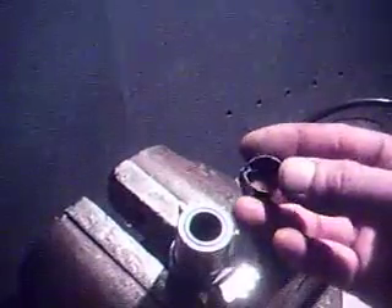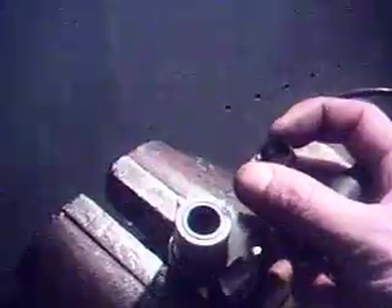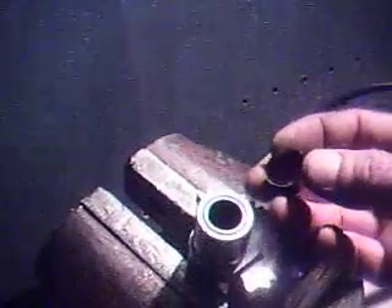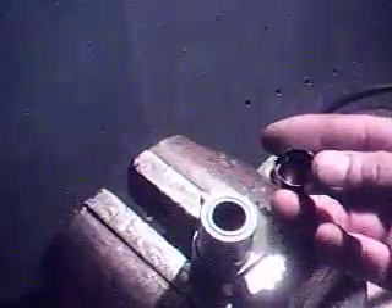After reading a post over the years, I took a grinder on the Dremel and ground away one side of the Torrington cage because the bearings had come loose. The only reason I noticed is because I couldn't fit on the side case, and before hammering I inspected it, and the bearings were all loose and came out.